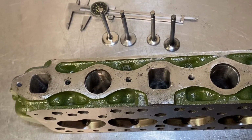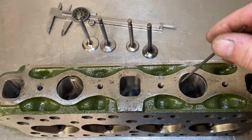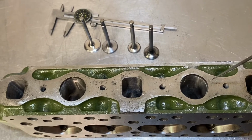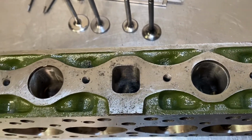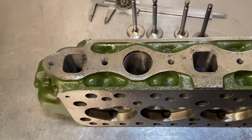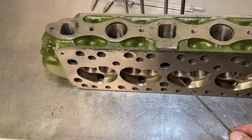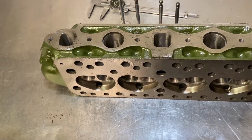Ports, not as big as you'd make a 1275, but pretty big. This has got a normal retaining groove for a twin carburettor setup and a very square inlet port as opposed to a round port on an earlier 998 head. This one's actually going on a supercharged engine. The 295 head is ideal because it uses a much bigger, much more open chamber.